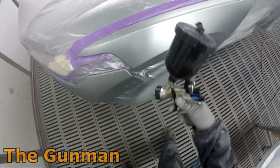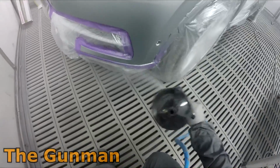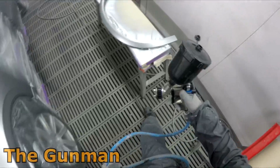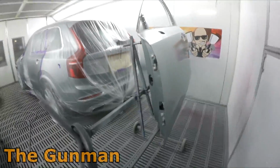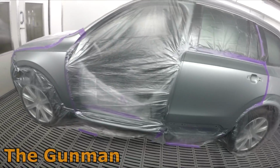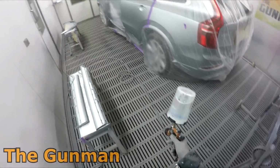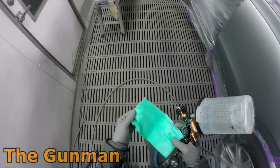And I'm kind of lucky that I get to do this stuff on the daily. Some people, obviously, may not, that are trying to watch these videos and pick it up, and then you might just say, well, this is what Gunny did, it's not working for me. But there are many variables in this trade that are going to affect the finish that you're going to get. The pressures, even the temperatures of the day, the kind of paint you're using, have you thinned it down properly. There's lots of variables.